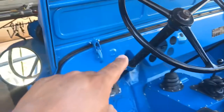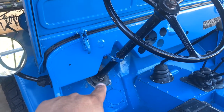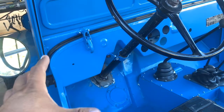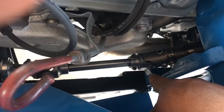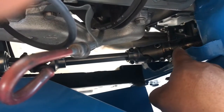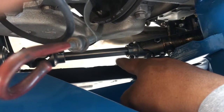I still have to finish the steering setup here. Right now, as you can see, it's tack welded. I need to drill some holes and bolt it and then clean up those tacks. So this plate here, you want it to be removable, so if you ever need to go in there and start working on the steering or steering column, you could actually remove it. And this is the inside. I notched a little bit here on this support, and obviously the steering column goes all the way down to the frame, and then it has the old gearbox setup there.